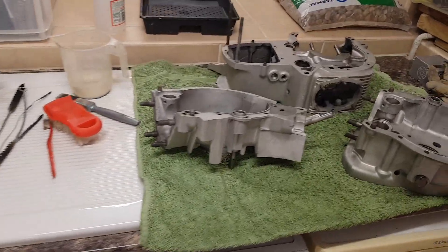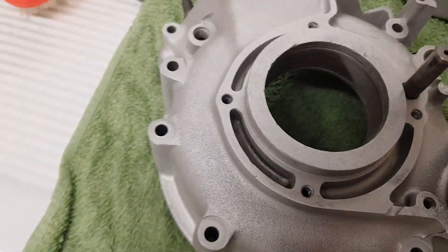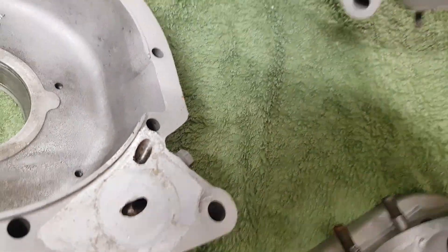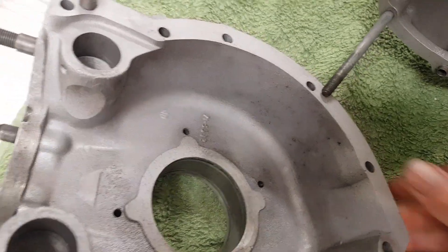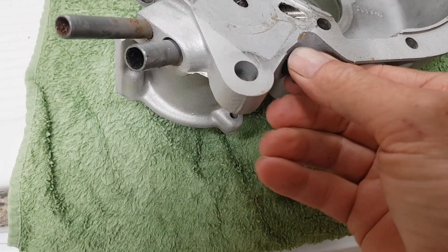Right, cleaning-wise, now it's the turn of the crankcases to be cleaned — in particular all the oilways. On this drive side we've got the oil pump and all the oilways that go in and out here and all through the casing. Then we've got the central crankcase, which has drillings in the front for the oilways that then go up through to the main bearings. All these cases have got to be really thoroughly cleaned because they've been vapor blasted. I just realized there's one left there — that's the anti-drain. I put some plugs in just to try and stop the worst of the vapor grit getting in.